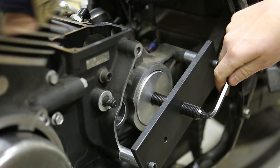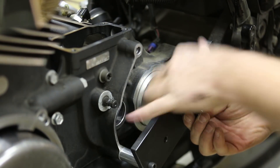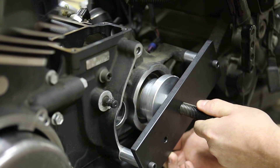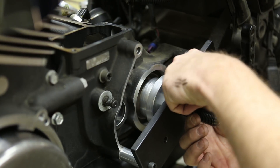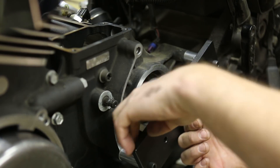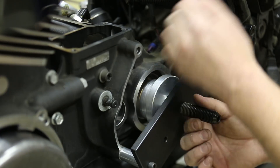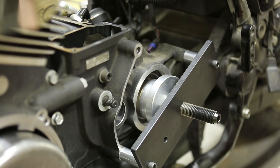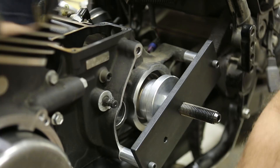Back these off. So you want to run the nut all the way up until the cup adapter, and then you want to pull the tool back. Then you just want to do a visual inspection all the way around and make sure that the adapter is in there flat against where the snap ring is going to seat. It'll stick out a little bit in there. The next step is after we remove the tools, we're going to put in the snap ring. Everything looks good and flush in here, so we're going to remove the tool.